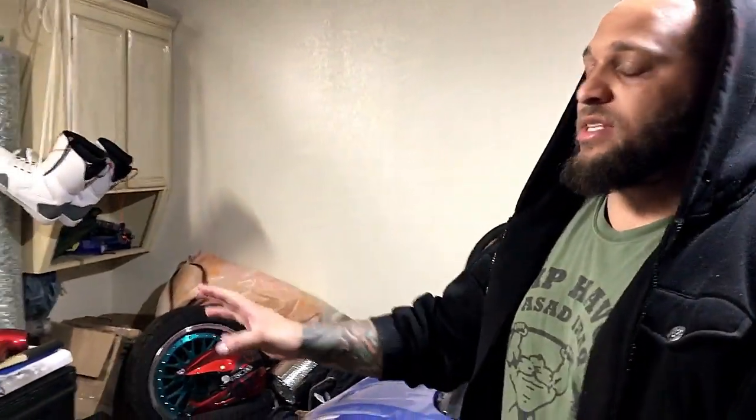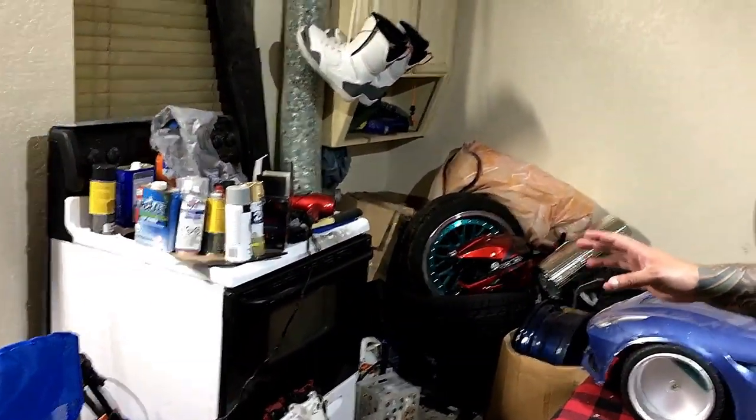What about the people asking about a normal stove? What would you say about that? A normal stove, man, is so much easier than the bigger ovens. You have racks. It's easy to set things on the racks, especially valve covers. You can literally coat on the rack. So you take the rack out, place it wherever you want, coat it, put it back in. It's easy. It takes less time as well because it's not as big, so the coils don't need to heat up the whole box.